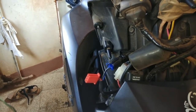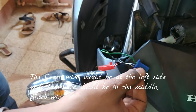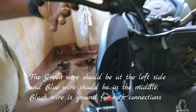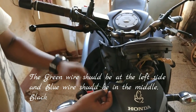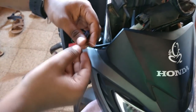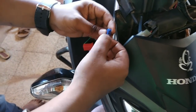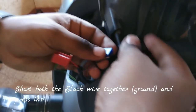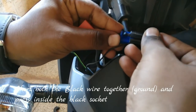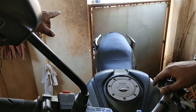The green one goes to the remaining point - the extreme left point. So we are shorting the ground now. We have already shorted the green wire which is the brake wire, and the middle one is the starter wire. The black one is the ground for both. I am giving the ground for the brake light switch now, as you can see in the video. The connection is already done - the only thing remaining is to give the ground. It fits perfectly. There is nothing like cutting the wire or anything, and by this your warranty will also be safe. The brake light switch is working.